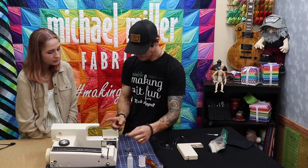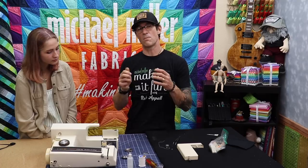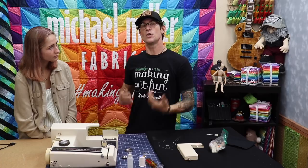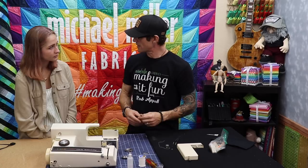Okay. While I'm here, I'm going to use a dry brush, and I'm going to come in here and dust this out. Earlier, I took this out to my garage and I hit it with my air compressor, which had a moisture trap on it. You notice I did not say I'm going to use one of those cans of spray air. Those cans of spray air are, in my opinion, but with a lot of fact behind this, CO2 propelled. So after about the third or fourth press of the top, they spit moisture. If you take moisture plus dust, that makes mud at the back area of the machines, things you can't get to. So anyways, I'm just going to dust this out like that, okay?